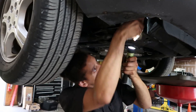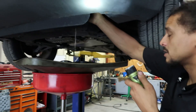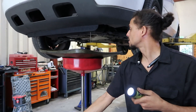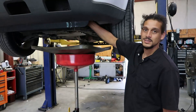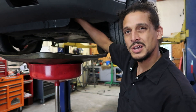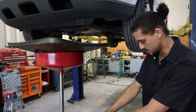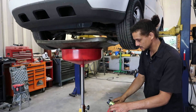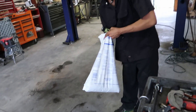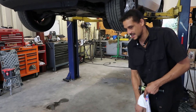I'm not going to do it that way because I have a drain hole, but I just wanted to give you a quick demonstration. I've got my coolant draining here. Just like I said, you just need a tad out of the system. A rule of thumb — you could probably let it drain for about a minute or two. That should be enough so you won't suck in any coolant while you're trying to do the test.